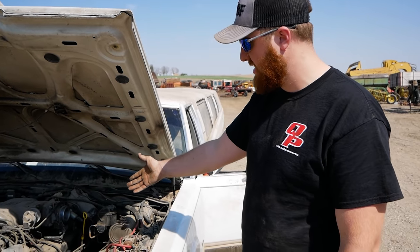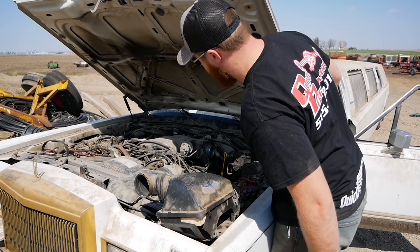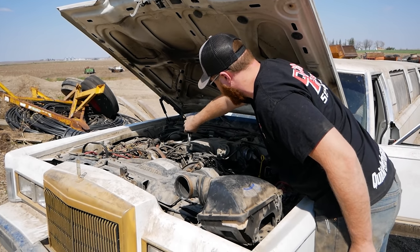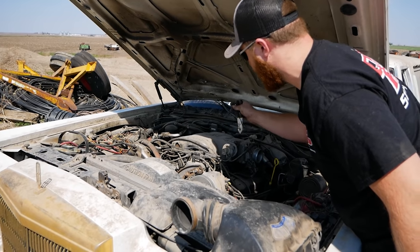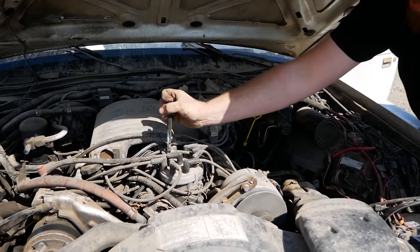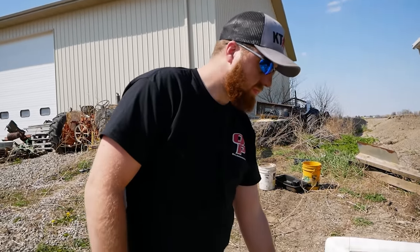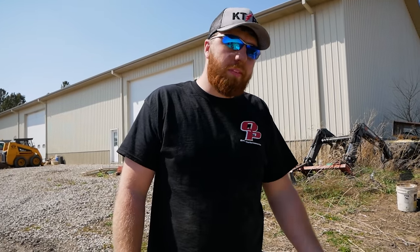Dirty might have been our problem. That's unreasonably smooth. Let's see if this makes a difference again. It's still a little shaky, but you'll have that. Aha! That one still doesn't do anything. What's the other one? This one? No, not that one. That one does something now. That's running pretty okay, honestly. I think maybe smacking those injectors might have shook it loose. But I don't think it was really a spark problem. I mean, could have been the cap and rotor as well.